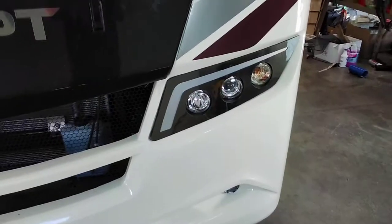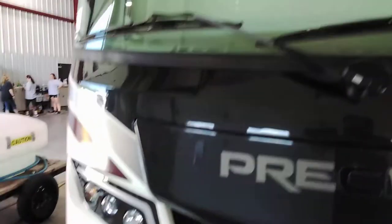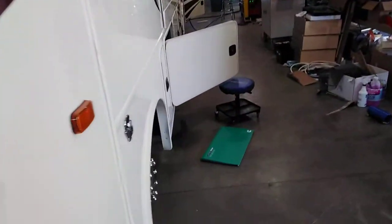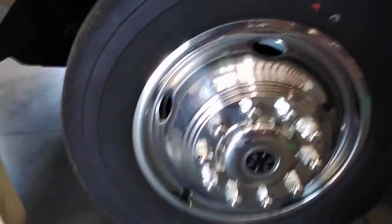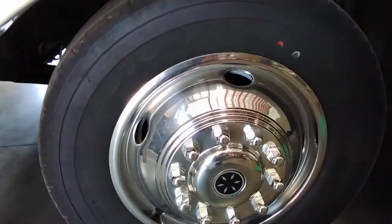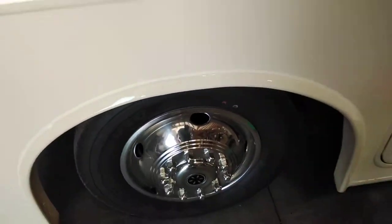The chassis battery is up front; the house battery is separate. There are decent lights on the front of this, as well as fog lights, and a front license plate holder in case you ever need it. Front tires as well as rear tires are all 82 PSI. Check that periodically throughout your trip.